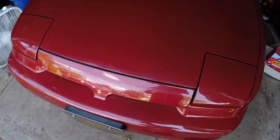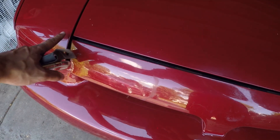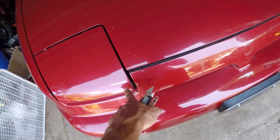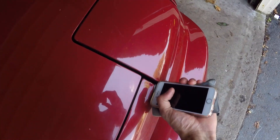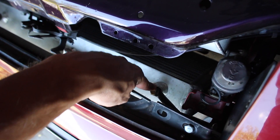All right, next thing I want to focus on for today is my whole front bumper fitment. It's just not lining up whatsoever and it's very uneven, so I'm going to see what I can do. I might even try and make some brackets for my lights, because they wobble around and they don't sit flush. Since I'm not retaining the factory bracketry because of the front mount, my bumper never really had any support up top, so I made just these little rods here, braced off the intercooler, just to prop it up a little bit.